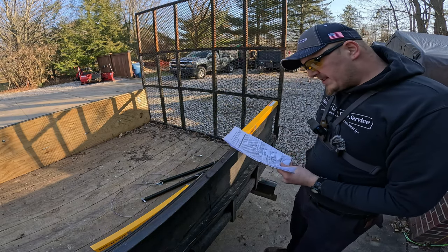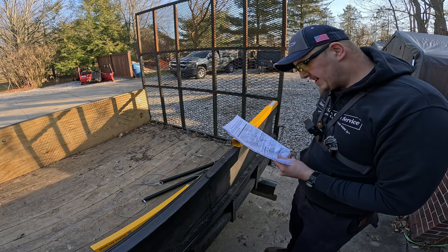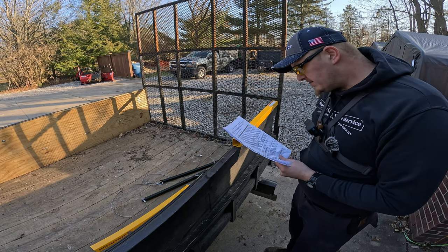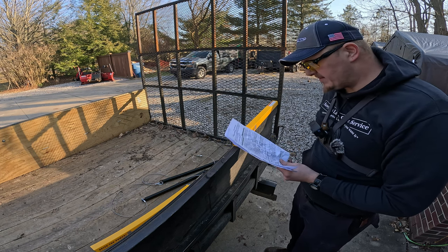Mark center the housing before placing a housing onto the side rail without disturbing placement, and so on. Drill half inch holes, which are oversized, down through the side rail, or in this case, the wood, where you made your marks. Insert the 5/16 bolts, which are now aftermarket. They were 2.5 inch. I got 4 inch ones instead.